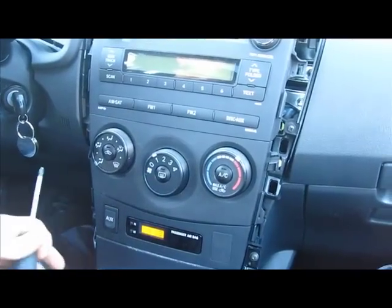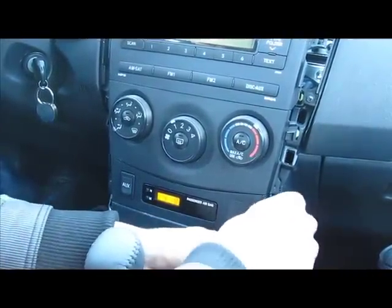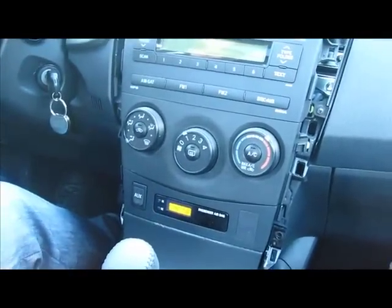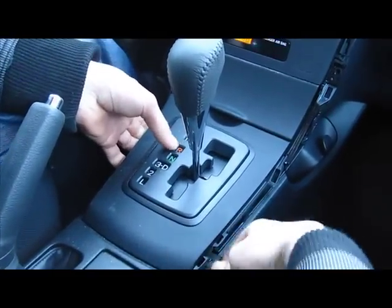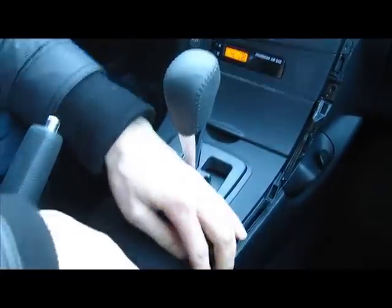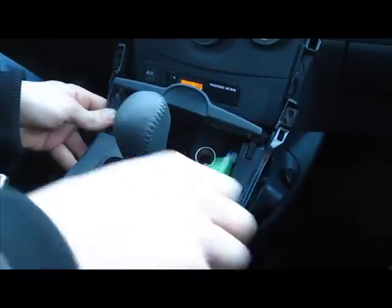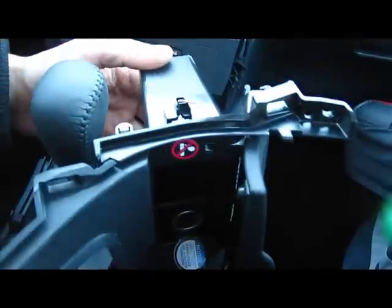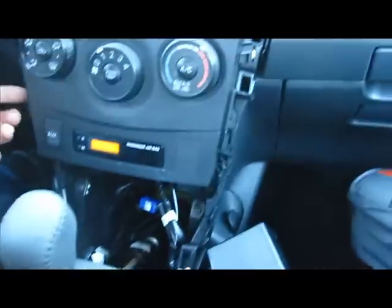To remove the bottom part, there are two Phillips screws — one here and one here. Undo those screws, then use the panel tool to remove the piece from the bottom; it's also held in on clips and comes off. You'll need to put the car in neutral to get it out. You don't even really have to disconnect it unless you need to take out this panel to drill it for the cable — there's just one plug for the socket.